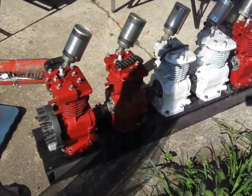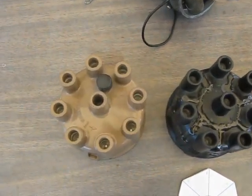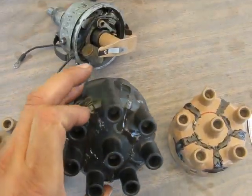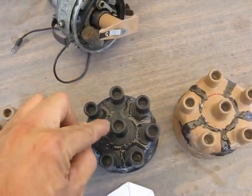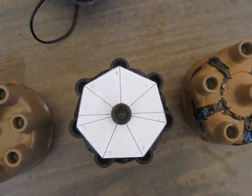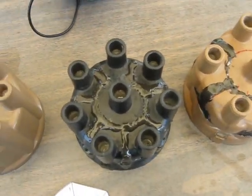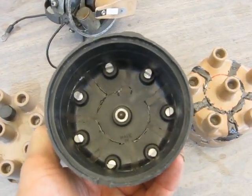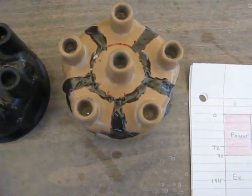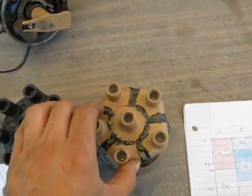As you can see I have the seven bolted down here. Here you can see the distributor caps that I've modified. The one on the left is a regular V8 distributor cap. I took one of those, left one terminal in position as well as the central one, and then I made a template on CAD to show me where I had to position the new locations for the spark plug leads. Then I cut it all apart and JB welded it back together, and the rotor spins around okay inside of it. So there we have our seven cylinder cap. Over here I did the same with a six cylinder cap, and I have one for a five cylinder. The five has more JB weld on it since the gap was larger between the terminals.